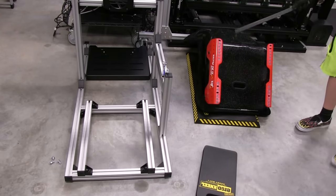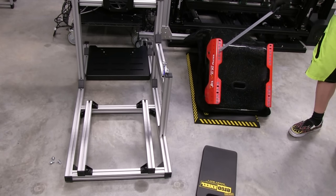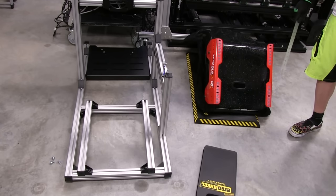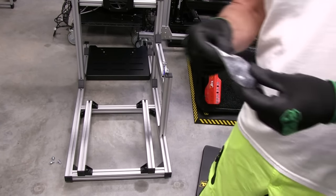I'm going to use this seat here — it's a Prism seat, medium size, with aluminum side mount seat brackets. The reason I mention they're aluminum is because they are thicker than the normal steel seat brackets. Steel ones are about two to three millimeters thick, whereas these are a full six millimeters thick — quarter inch — because they're made from aluminum. So I'm going to need longer bolts than come with this particular cockpit kit, no fault of their own.